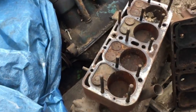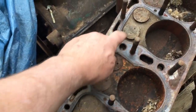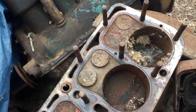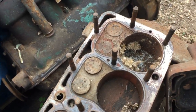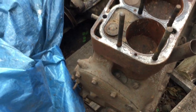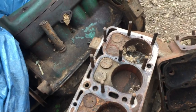Just wanted to show you what I found so far. The valves actually don't look too bad on top, other than being a little rusty, so that's good news. That number four cylinder is certainly the worst. We'll see what it looks like after we get them apart and run the hone through it a bit and get the initial rust off.